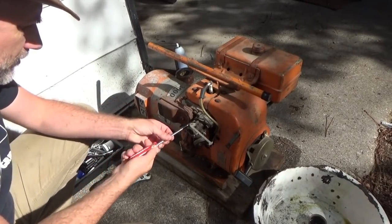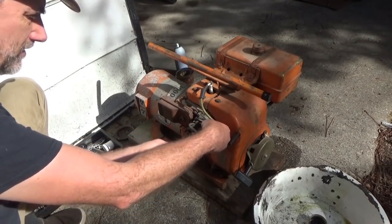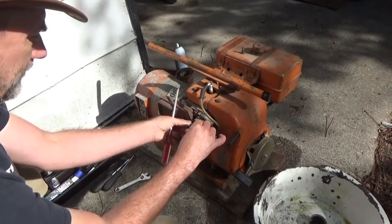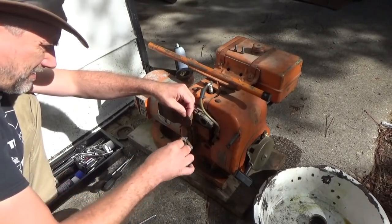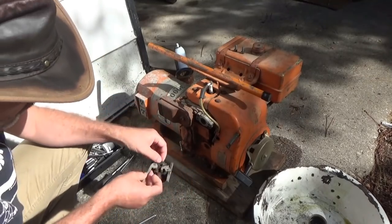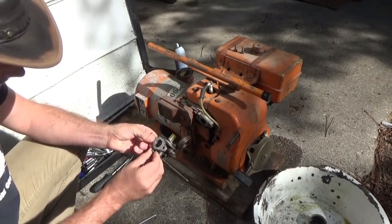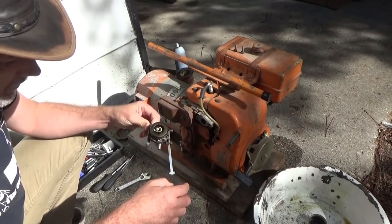The carburetor comes off with two Phillips head screws. You want to hold it in place because the linkage is connected to the carburetor — that needs to come off too. Remember which way it's bent and which end goes where. This is going to have to go on the workbench for some serious cleaning and soaking. I'm going to put some carburetor cleaner in the holes and let it soak. The top part is at least clean, so it might not be as bad as I thought — I'll run some wire through there and soak it.